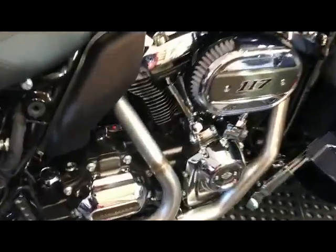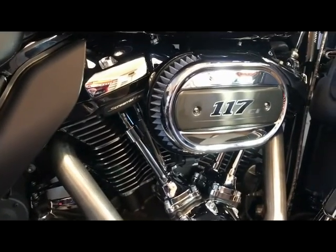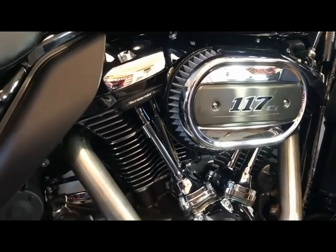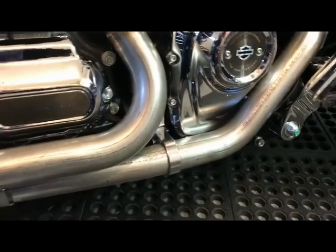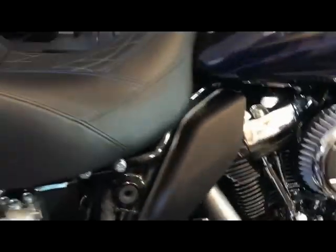So here's where we are so far. The head pipe is on, torqued. Using a torque wrench, those head bolts have to be torqued to 130 inch-pounds. And along with that clamp, and as per the instructions, that head pipe is supposed to be torqued down before we move forward. Then, what we're working on now is underneath the bike, and I wished I had a lift, but the crossover pipe isn't on yet.